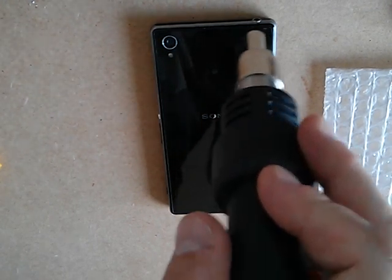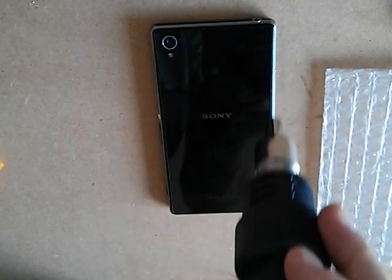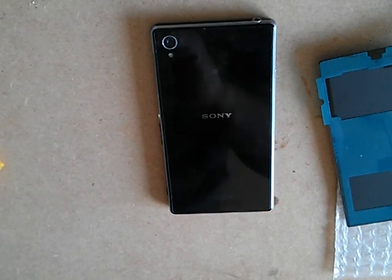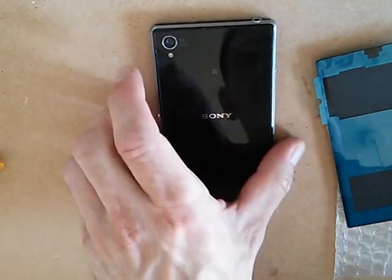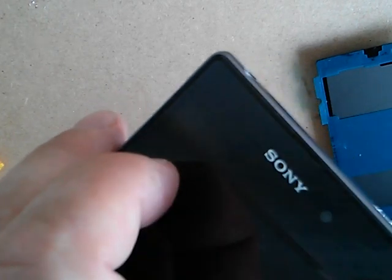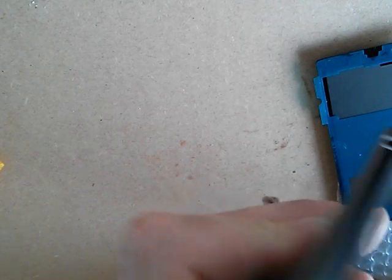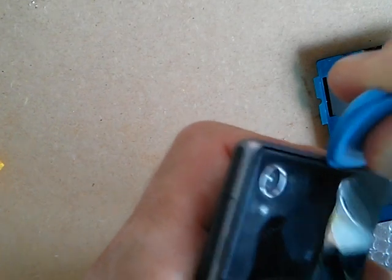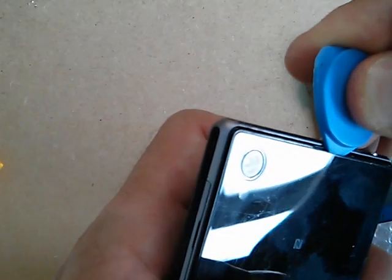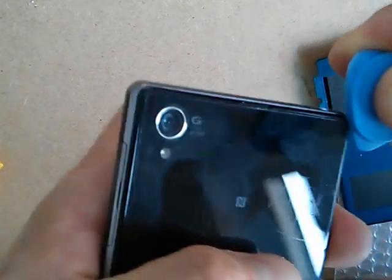This will take a minute or so — I'll just be doing this for a minute, a minute and a half maybe. Okay, turning that off now. We'll use a little pry tool. You can see at the top there, turning to the light, there's a little recess — there's one on the front as well, which probably doubles as a microphone or something. I'm going to use one of these little plectrum-type devices because it looks just a little bit harder. Take your time — I can just hear it pop off there a little bit. Just gently work around the outside.